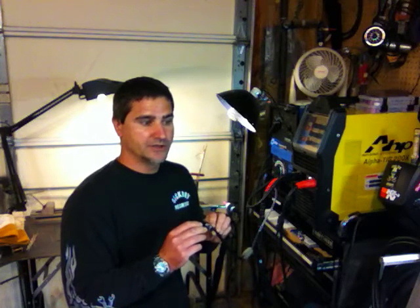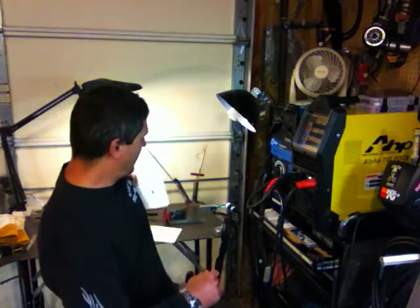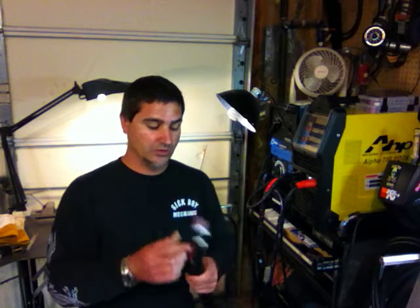Now with this 7-pin, like I said, only 5 wires out of the 7 are used, but 2 of the pins are soldered together — as per SSC's wiring diagram provided with the foot control. I tried to find a wiring diagram for the AHP and couldn't come up with anything, so I reverse engineered the foot pedal, came up with all the color codes, pin numbers, and resistances, and then did the same thing for the hand amp control. I got all the pin numbers that work with the Lincoln and color codes that CK uses with this style hand amp control, and put them together to make something compatible with the AHP.